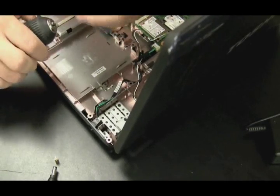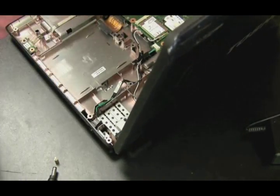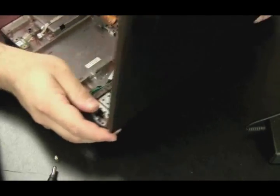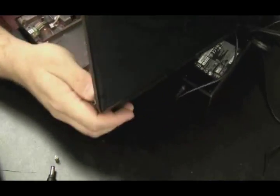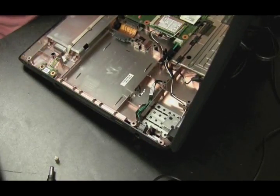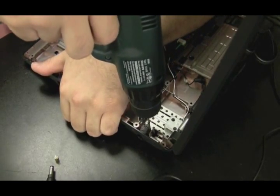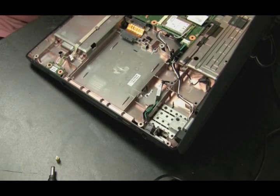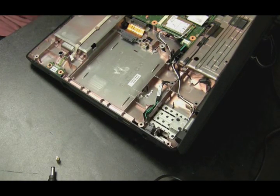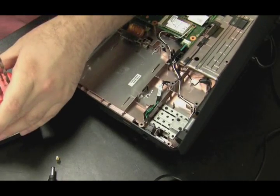I'm going to take a drill with a bit that's just a touch bigger than the width of the screw. You don't want the hole too small since the standoff is threaded — you want the screw to fit through gently. But you don't want to make the hole too big either, otherwise it's not going to gain any traction and will come loose or rip through the bottom of the laptop. The drill had about two seconds of charge left, but it was enough to make the hole — you can see some shards of black plastic coming up through the hole.